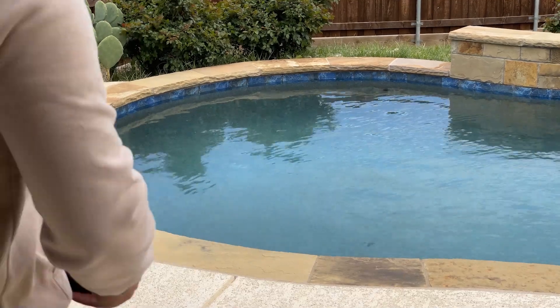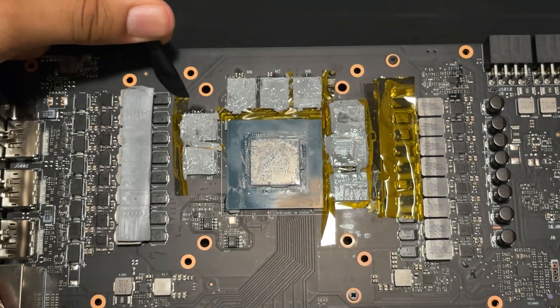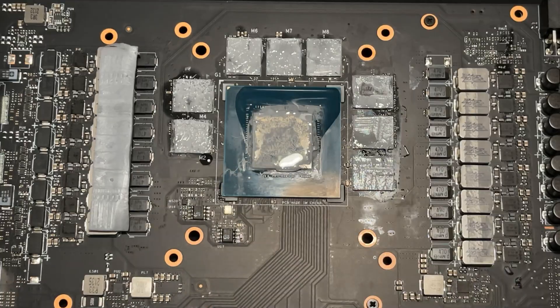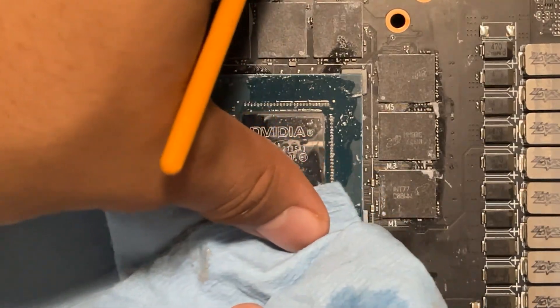The first step in any good GPU cleaning is... definitely not bathing the GPU in water — I'm just kidding, don't do that. Instead, I got around to de-shimming the GPU. Now, versus the last video, I've upgraded to 99% isopropyl alcohol, and the difference is literally night and day. I was so surprised to see just how much better it actually cleans the GPU. If you want to make your life 10,000 times easier, I'll have 99% isopropyl alcohol linked in the description. It dissolves very quickly and will not damage your components, so long as you wipe it all off after cleaning.